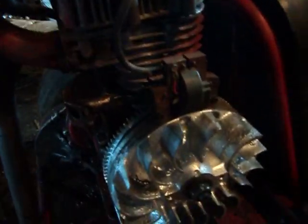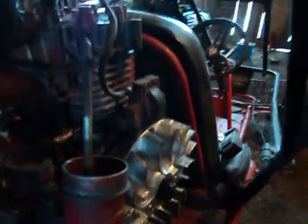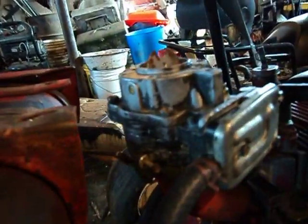Sounds like quite a bit of work but I don't know if I'll do that — I might. There's no other videos on YouTube about it, just one guy explaining it. And if you know this motor, it takes the updraft carburetor so it originally mounted like that, but I took the 90-degree fitting, flipped it upside down, and used a 19-horse carburetor.